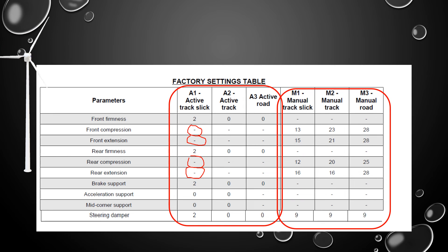In the manual mode, you have individual control over the front compression, front rebound, rear compression, rear rebound, and also the steering damper. This is one of the reasons I chose the factory version over the regular RSV4 — the factory version allows me to switch out of automatic mode and into manual mode and adjust the bike as I would if it were a regular bike.